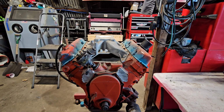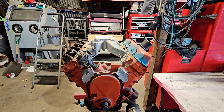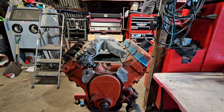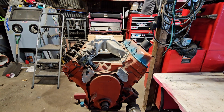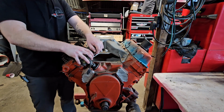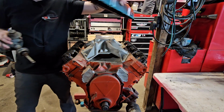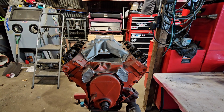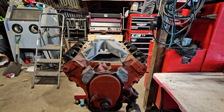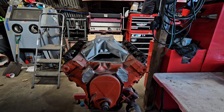All right, so here's the old 440 we built 10, 12, 11 something years ago. You were just a baby. I was just a little baby. It's supposed to be pretty rowdy. At the time, they weren't making 440 pistons that much. This is the last set of high compression standard bore forged pistons. If I remember right, it's pretty close to zero decked.